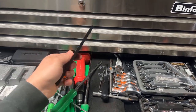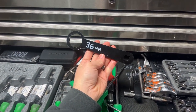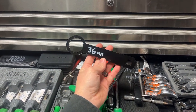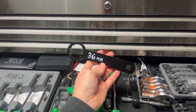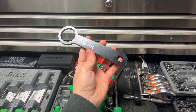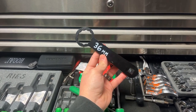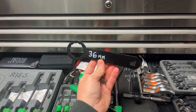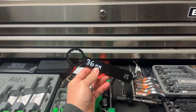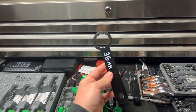This dude right here is for a Harley rear axle nut. If you've ever worked on motorcycles, especially full dressers like an Ultra, to get to that rear axle nut you have to remove the saddle bag and often the exhaust — it's a royal pain. This tool, with its half-inch hole, lets you put your ratchet or extension in and get behind the saddle bag to remove that axle nut without disassembling the whole rear end. It's probably about $20 — a lifesaver.